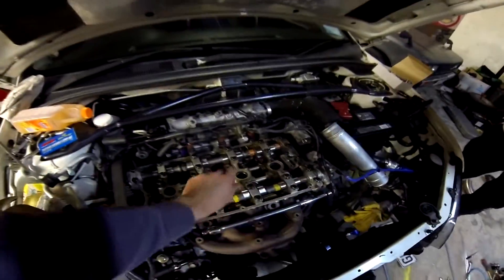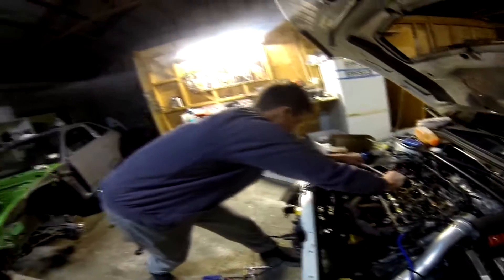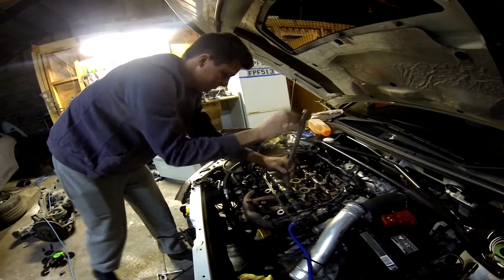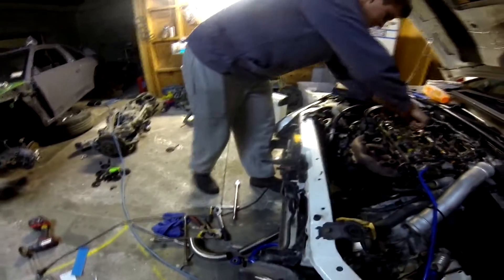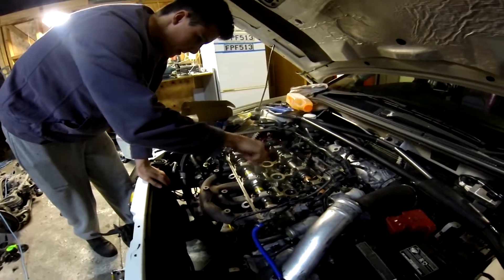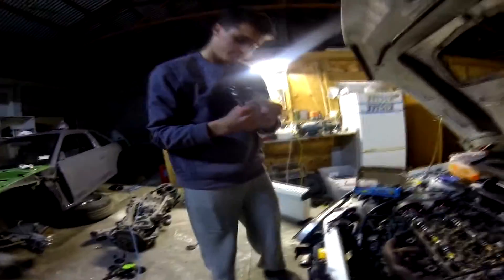No coolant in the block, otherwise you'll get head gasket leaks of oil. So I'm gonna go ahead and take this first one out. You gotta put a bit of your back into it, but that's the first one coming out fairly smoothly. I've just got a half-inch power bar and a semi-long extension. First head bolt — nine to go.